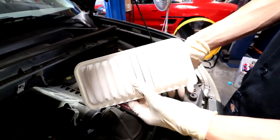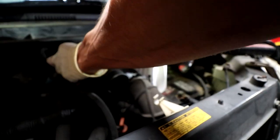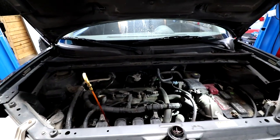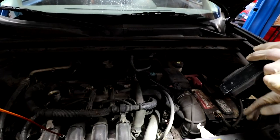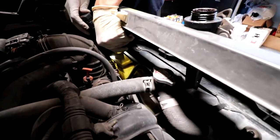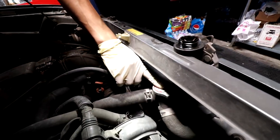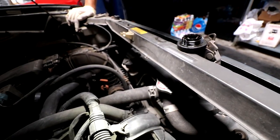The only other check under the hood is the air filter, so let's pop that off. As you can see, it's a brand new air filter, so nothing to recommend there. One nice thing about Toyota is pretty much all the filters and everything are very easily accessible and easy to inspect, which makes for nicer express services. Also, check the coolant reservoir and make sure it's topped off. If it's not, top it off with water. Usually cars will be coming in hot, so I don't recommend popping the radiator cap, but if the car's been sitting, you can pop it off to make sure the coolant level is good.